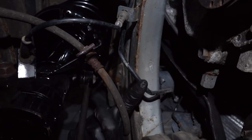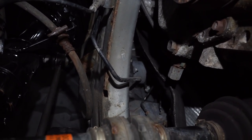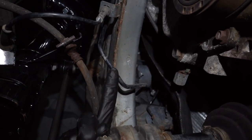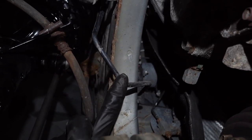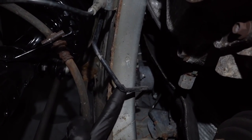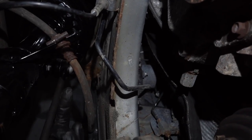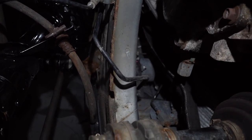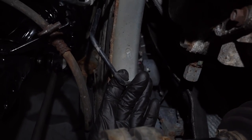You can follow that steel brake line, it comes down around here, and then of course it leads up. Looking at this brake line right here, it doesn't look as though it's metal. This actually has a coating on it, and that's a protective coating, which is gonna prevent it from rusting or anything the like. Now, as you can see, everything that we can see in this particular area looks great. So like I said, you'd want to obviously check both sides of the vehicle. This is very important. You want to make sure that the line looks good.